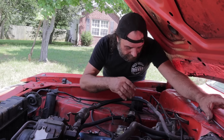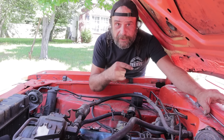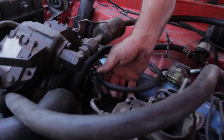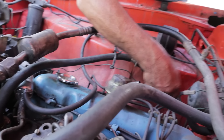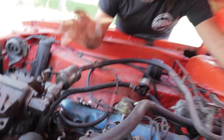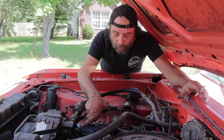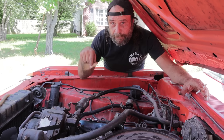That's the one we used on this car because it has a factory vapor line going back to the tank that was part of the emissions control system. It has a 60 thousandths of an inch orifice in the tank itself. So we used the non-orifice vapor separator, ran fuel line from the third nipple over to the hard metal line that runs back to the tank. As the temperature rises and the gasoline starts to boil, it gives it an escape route — the pressure has a place to go. Because the fuel is always moving to some extent, it doesn't stay stagnant in the fuel pump long enough to boil.